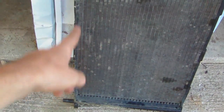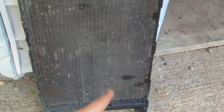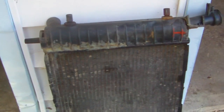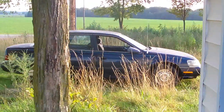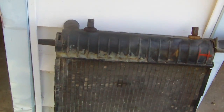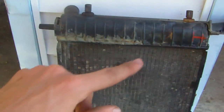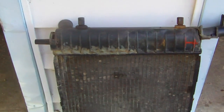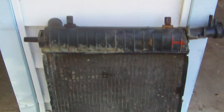Other than that crack, this thing is just fine — all these fins, none of them are broken or damaged. You can see I did a patch job on this at one time. This actually used to be out of my 1989 Sable that I drive. It was leaking around the seal, so I did a huge mess of pipe cement, rubber cement, and window caulking — anything I could find that was resistant to liquids. I layered it one on top of the other, and that thing never leaked once. That is a good temporary fix if the seal's going out on these plastic-ended radiators.